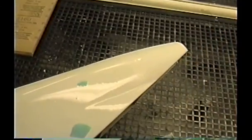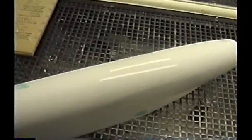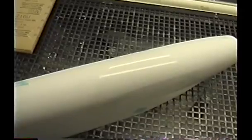This material, once you get it wet, M600, and then I'll dress off the whole part. You know how quickly that fills in. And the trick is make sure it's good and dry, give it plenty of time to dry. We got some other little flaws here, and we'll sand the whole part out, and then that'll be ready for the next coat of primer.